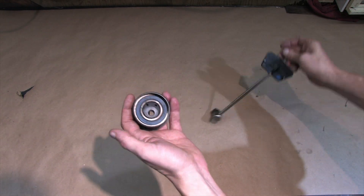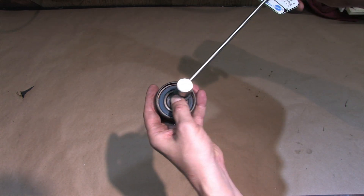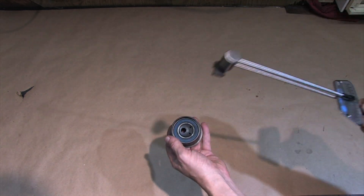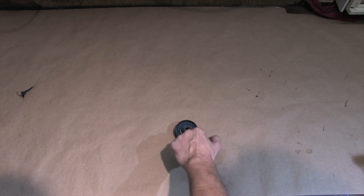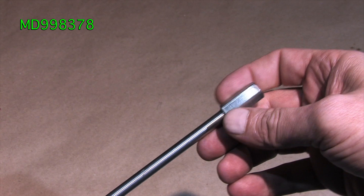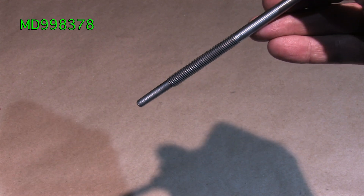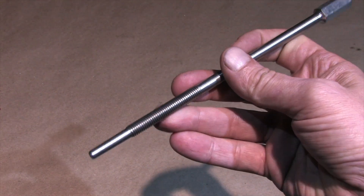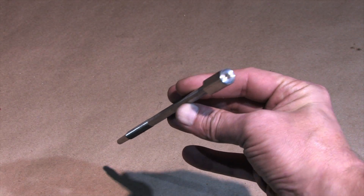I'll show you the concept of how this works. There are actually two different tensioners on a 4G series timing belt — one's hydraulic and one's mechanical. The mechanical one is the happy face pulley. In order for the hydraulic tensioner to function in its proper range, you have to manually set the preload on the happy face pulley. When installing the timing belt, before you torque down the happy face pulley bolt, you insert the pins into the eyes and put a specified preload tension on the belt. Another popular tool is the timing belt tensioner tool, MD998378. This is useful for people servicing 4G engines with the original engines in their chassis, but for a 6-bolt installation in a 2G it's useless because the tensioner doesn't line up. You screw it in to push on the tensioner arm to relieve pressure on the timing belt so you can service the valve train without removing the hydraulic tensioner and re-compressing it — it's a time saver.